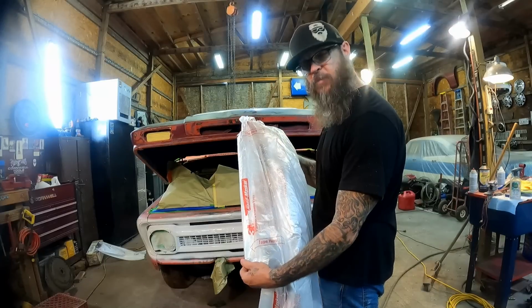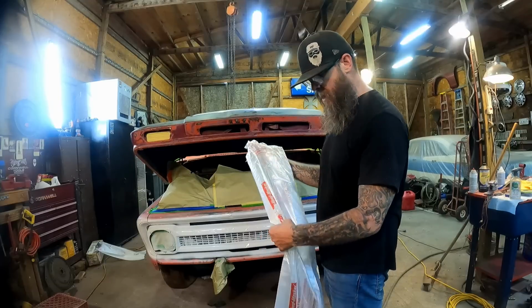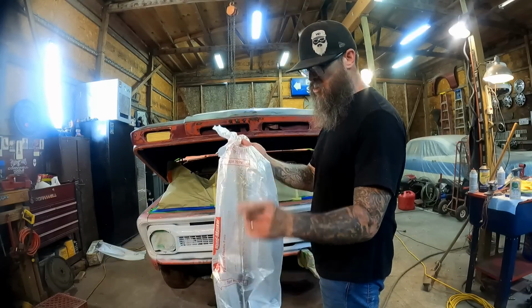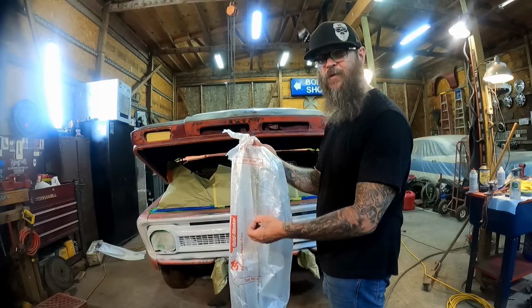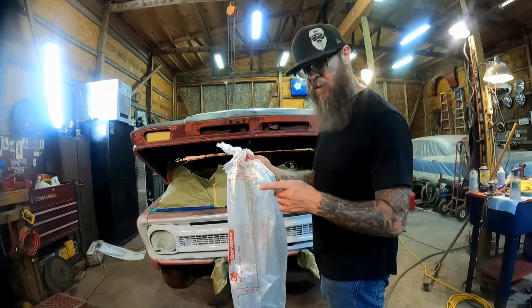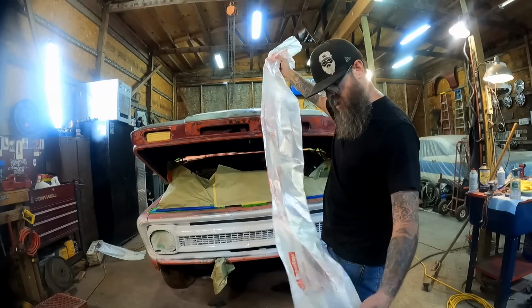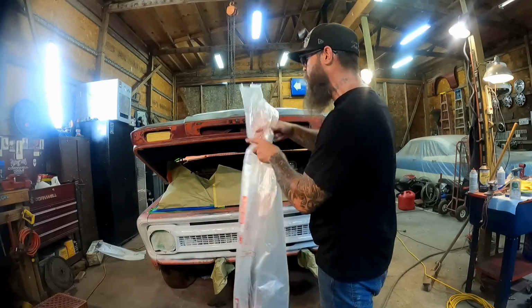So here's our plastic, some good 3M stuff. This was sent to us by a subscriber, much appreciated. The good thing about the 3M is that you can get your overspray on it and it won't flake off like a lot of plastic does. So there's no need to run paper around it or anything. You can paint right up to this stuff. I've never had an issue with anything flaking off of it. It's really cool.